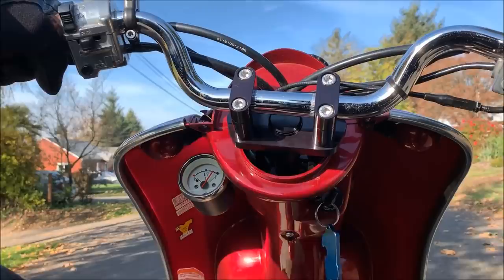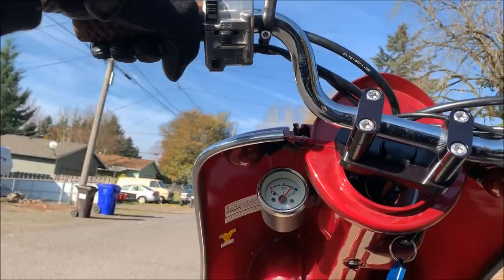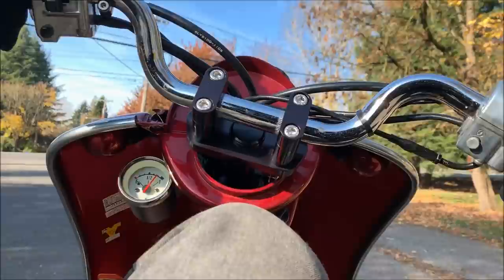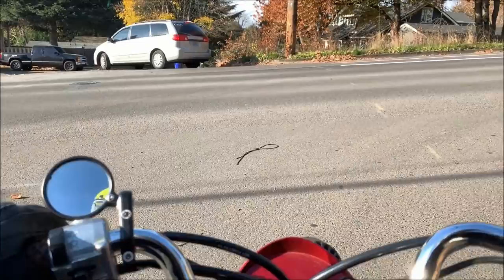You just gotta, that rear brake is really important. And again, like we said in the first explained spot, make sure your rear brake is good. Deglaze it. If your shoes are worn out, replace them. If your cable's sticky, try to lube it. If that doesn't help, get a new one. You're gonna make your life a lot easier. If you have a squishy rear brake, it's a recipe for eating crap.